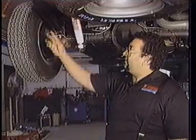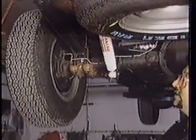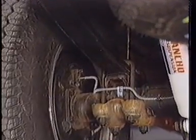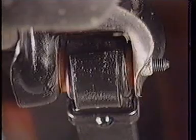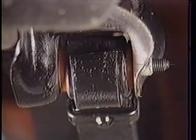In contrast to the Ranger lowrider system, we have here a C1500 late model lowrider system. As you can see, we utilize a new computer-aided design leaf spring assembly rather than extensive bracketry to lower the rear of the vehicle. We get low stress, good ride, and still maintain some load capacity. The spring also utilizes the famous Rancho DuraCrush red urethane bushings.